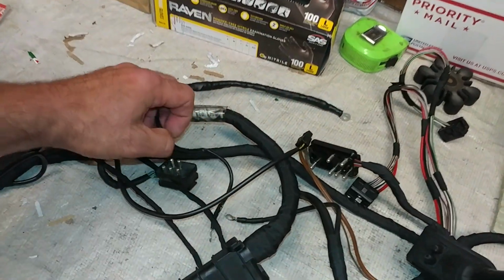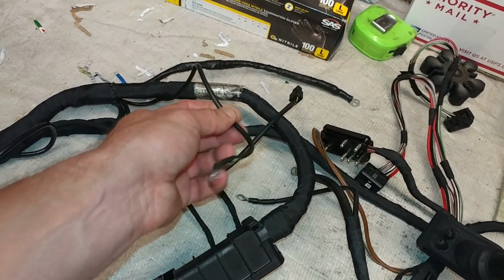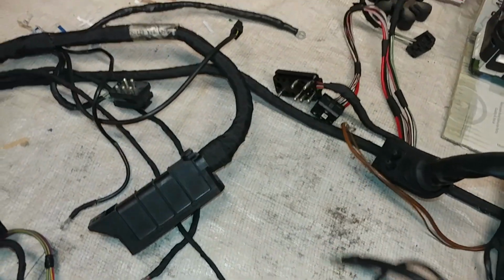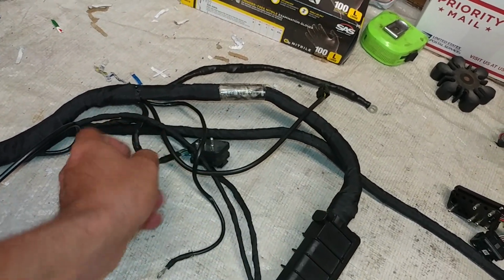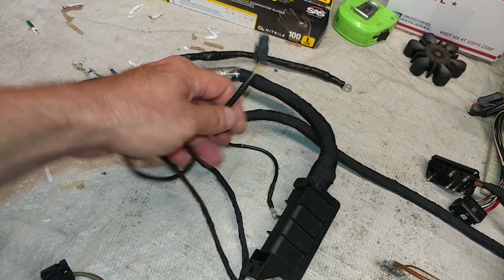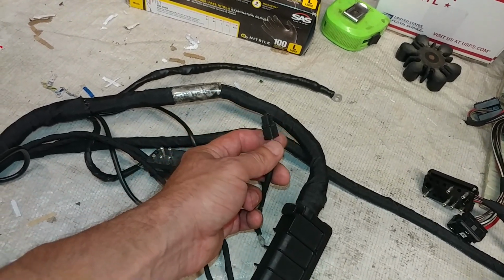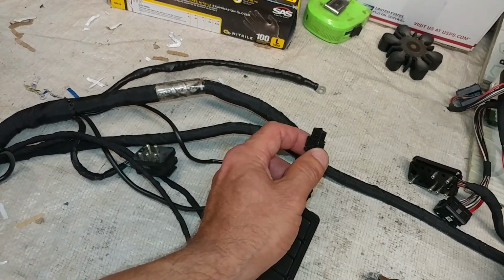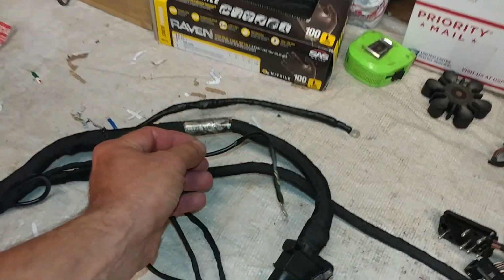the main power connection next to the computer box. This is probably like ignition, an ignition wire. Again, that's near the main engine control module area, so this is where you usually find the main power junction connection, X4, I believe it is, X4/1. This might be the connector for the computer box coolant fan. It looks to me like that's what it is. Again, this might be the ignition.